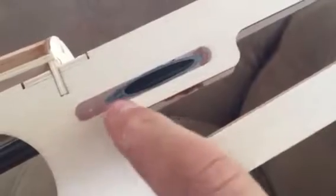I mix enough filler balloons in with the epoxy until it's thicker than peanut butter — I don't want it to run or drip anywhere. Then I'll actually lift up the tail of the push rod tube a little bit to pack it underneath there, and then fill in the void on top and pack it around a little bit.